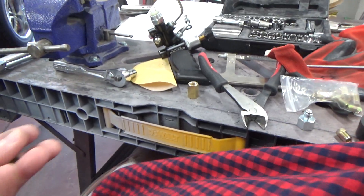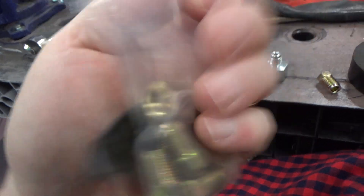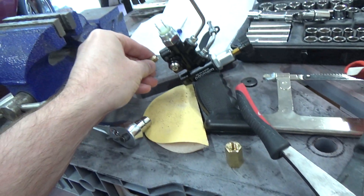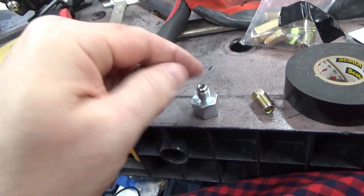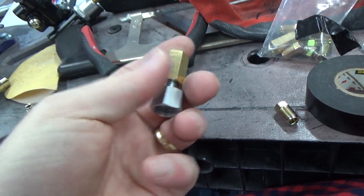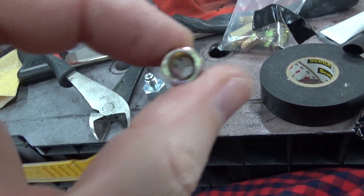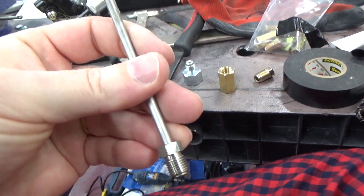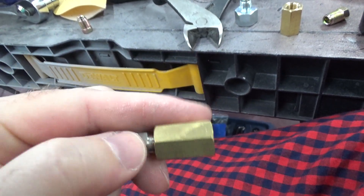Another one of those days that doesn't go right. I bought this little pack of fittings, which I thought were the right size — these will not thread in. If I thread this onto that adapter, it's sloppy. It's the right thread pitch, it seems, but just too sloppy. It's 10 millimeter, so these are metric somehow. Back to the drawing board on that one. Although this line seems to fit, oddly enough — maybe it's the same thing. Let's see if I can get this to thread in here.